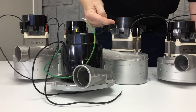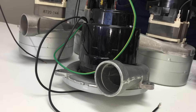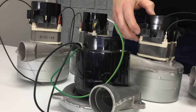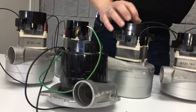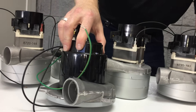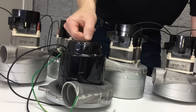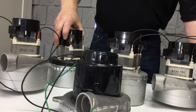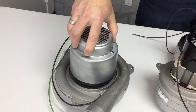Another difference: most of these vac motors have straight carbon brushes inside them, but this one here has rounded, curved carbon brushes — you can't see them because they're under the housing. Standard straight carbon brushes typically give about 750 hours of lifetime use before you need to change them. This curved-brush style gets about 1,500 hours because the curved shape allows them to be made longer and fit inside the housing. This other one also has a curved carbon brush system, so it also lasts about 1,500 hours.